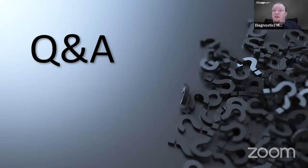Let's see. Ron's Economy Machine. Do you know if Snap-on's ever going to come out with topology on their scanners? It's been talked about a lot. I'm thinking of how I want to word this, because I want to word it carefully. From what we've seen on other solutions for topology out there, it's a gimmick, and it can often cause more confusion than it helps with. Because it's made to look like, oh, this is exactly how the network is wired on the vehicle, and more often than not, it is not how the vehicle is wired. And also with how it's laid out.